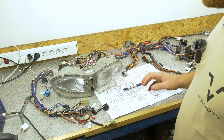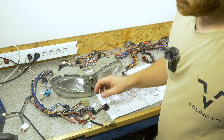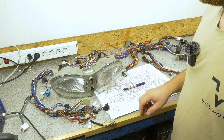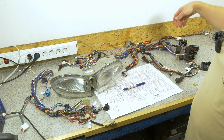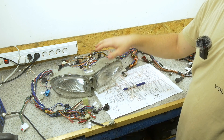This is really not a good solution in my opinion, because you always want to avoid having power going through your physical switches. You want the relays to do all the heavy lifting. Another big problem is that there's very small gauge wiring used both to feed the relays with power and for the power to pass to the lights.